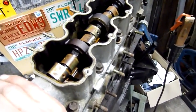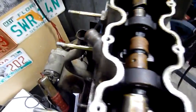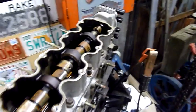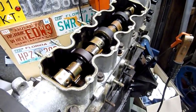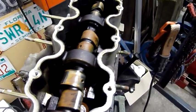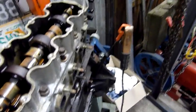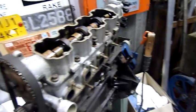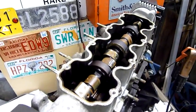Anyway, I've got the top end open and it's a mess. The PCV's blocked - that's not an oil return, that's just a crankcase breather up to the head so it can come out through the PCV. The whole thing's just clagged up with sludge and muck, and all this rust on the cam is just from combustion moisture that's not getting away - it can't because the PCV is so blocked, and it just sits on the camshaft and corrodes it.